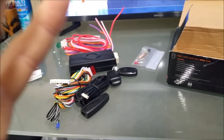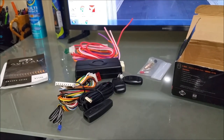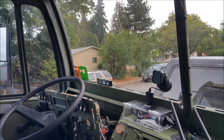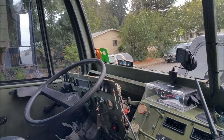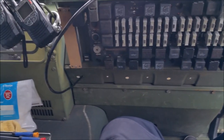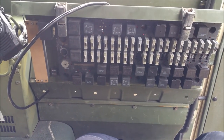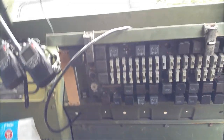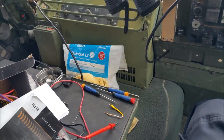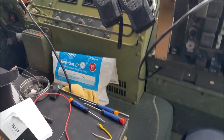We're going to give that a go this morning. After about three or four hours going through and checking the relays I need and comparing that with what I need on the driver's side, I figured out the easiest way is to tap into the relays for some of the signals. That way the remote start unit is basically acting as a giant relay with a remote on it.